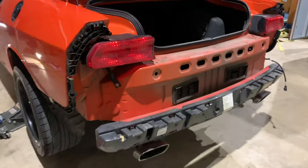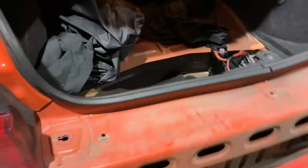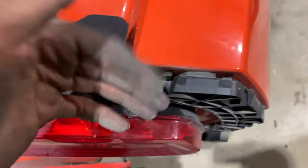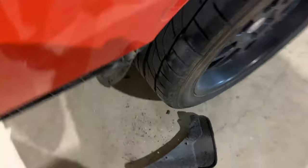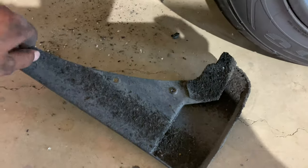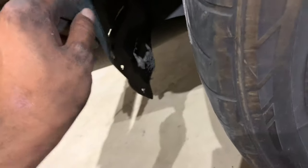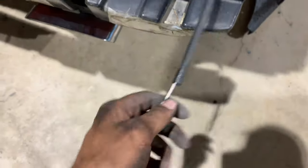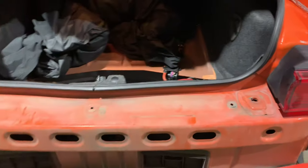The easiest way was to take the rear cover off. There were some push pins here, then an eight millimeter bolt here - you want to pull up and make sure you get the plastic rivets out of here. There's one plastic clip just like the ones up top, right about here. Also make sure you unplug the main body harness that goes to the rear reflectors. Then just pull it backward and set it somewhere safe so it doesn't get scratched up.